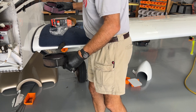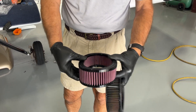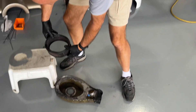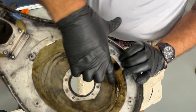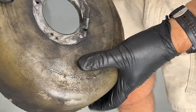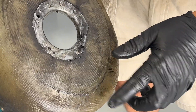Let me compare it here to a new one for you. You can see how much more flexible this new one is. And then what happens when they get hard and they shrink — especially in height, they usually do it together — it'll sit there inside this fiberglass air box and just auger a hole in it. So you can see we've just about cut through this air box here on this one.